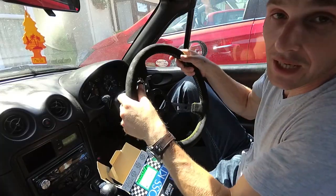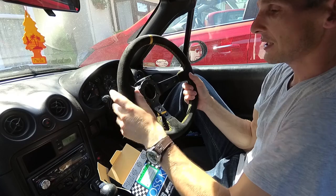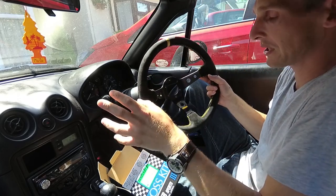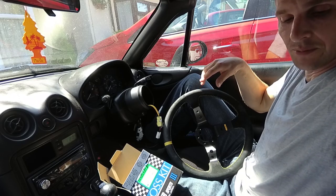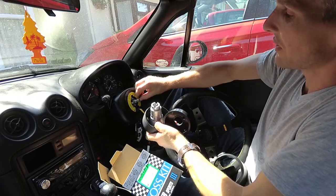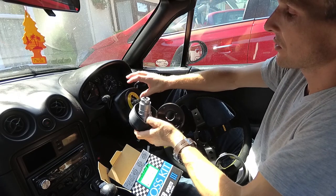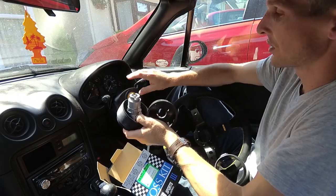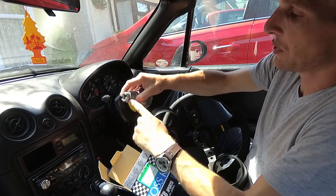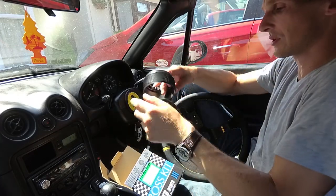Because this was going to be a budget drift build, I decided to save a little bit of money and get a secondhand steering wheel off eBay. I got quite a good deal — a code steering wheel with a cheap boss kit for 30 quid delivered. However, the cheap eBay boss kit that came with it is no way, shape or form going to fit. The lug holes aren't in the right place to accept the lugs on the clock spring, which clicks your indicators when turning left and right. Also, there were some cracks in the metal, so that's junk.